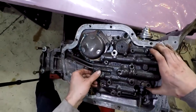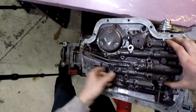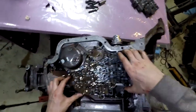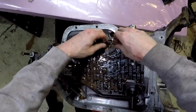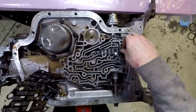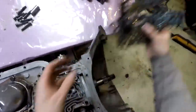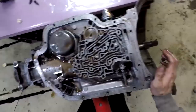So I'm going to release the valve body. I do have these two ports right here. We're going to pull this thing over, set it off to the side, and then we'll get the gasket off. The separator plate came with it. I'm just going to try to get this gasket off as clean as we can. So with the trans brake, some of those check balls are going to be removed or non-existent. I'll have to verify with the instructions, but something happens with those.